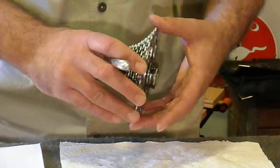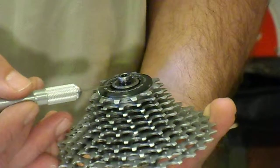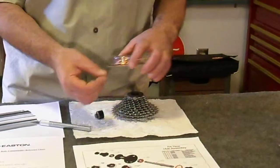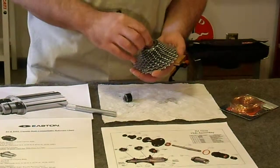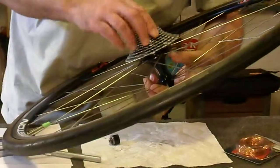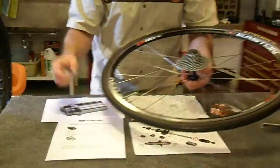The second area I noticed was on the front side — if you just put the nut in, there's not nearly enough clearance to get the frame, even with it pushed back, to where the face of the Campagnolo lock ring isn't going to interfere with your frame. What I did was manufacture a washer using copper wire, bent around a cylindrical part, then soldered and flattened to the thickness I wanted. This gets applied down inside the hub, so when the whole package is put together onto the wheel, it still spins freely, and applying the nut gives enough clearance to clear the frame.